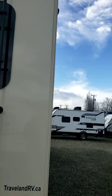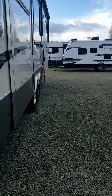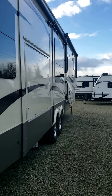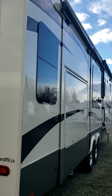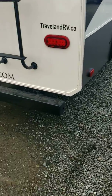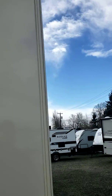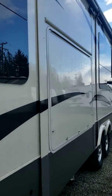It's advisable to go up probably once a month. This thing is a moving unit, and especially on the west coast with the hot and the cold, this thing will expand and contract quite a bit. So I always tell everyone, get up there once a month and inspect the seals, and also around all the trim, all around the edges. You want to inspect the trim, because if it does leak, it could cause bigger problems.